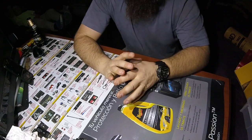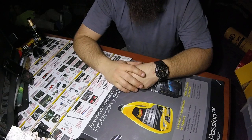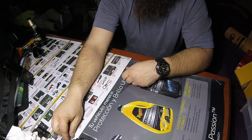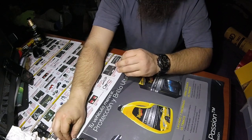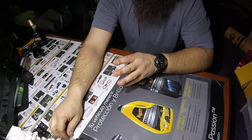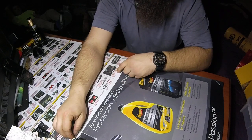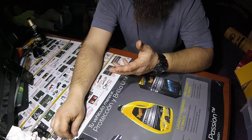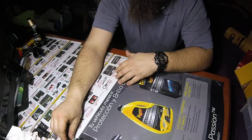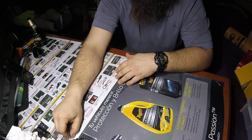But I got those in today. I figured instead of typing out a really long social media post and geeking out on it, I'd go ahead and just put it up here as a video so the subscribers could check it out, put a little more content up here, and encourage y'all, if you've got a 3126, or a C7, or I think International used HEUI, of course Ford, Navistar used HEUI, if you've got those, you probably should stick to factory OEM spec filtration.